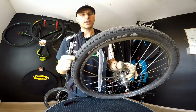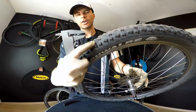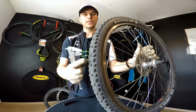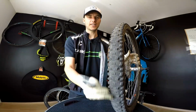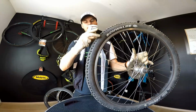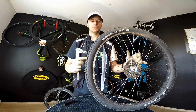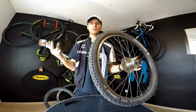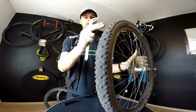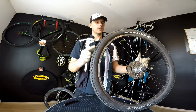So that's one thing. Another thing, maybe for newbies: you don't look at those knobs on the sides and say, wow, these are quite huge, so I can still use the tire, even though here it's completely slick. It doesn't work like that, because those side knobs will really last forever, because you never do so many thousands of kilometers just riding in the curves. So it's the center that's really indicating. That's the first one, the depth.